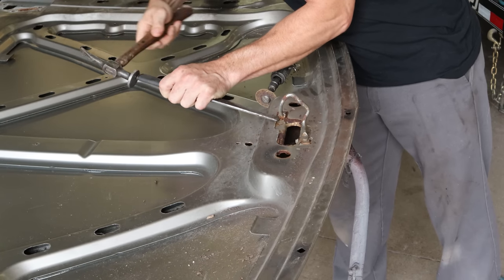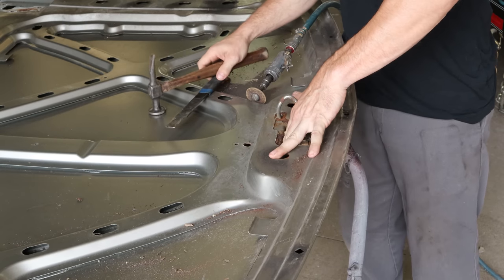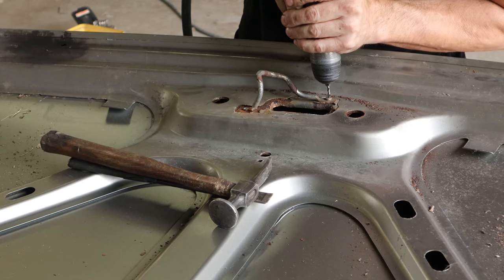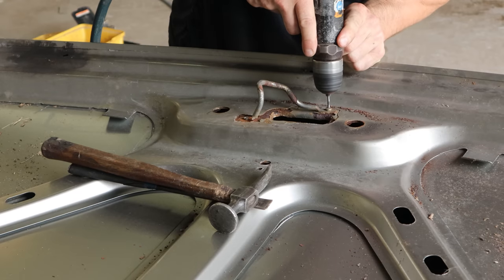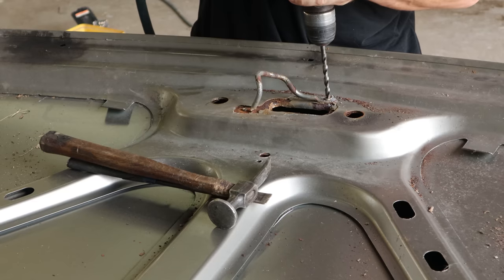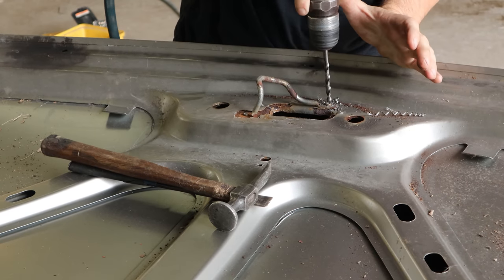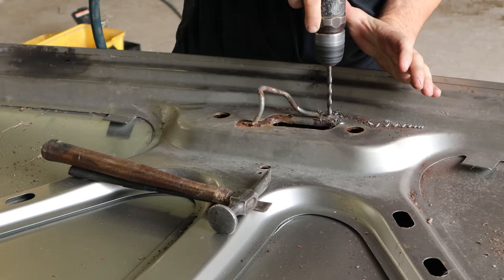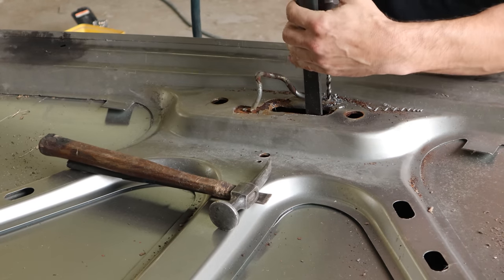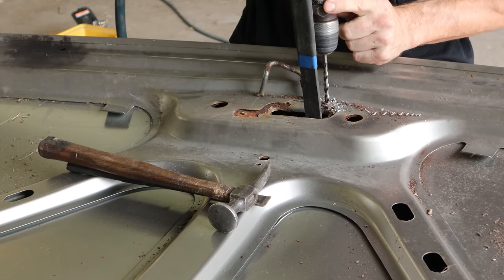So the latch is all mangled — there's no straightening it, it's actually got a crack in it. So we're going to knock it loose. There are some rivets in there, so we ground the rivet out of this side. Of course we ended up knocking the piece down inside the hood — the only place I didn't want it — but we fished it out of there. That method kind of sucked, so now we're going to try the drill method. We're just going to drill out the center of this rivet with our 1/8 inch drill bit, drill a pilot hole, then go back over it with our 5/16. This drill bit's a little bit longer and I really don't want to put any extra dents in the hood. So we have our angled breaker — we're going to pull up on the hood and push down on that, so if the drill bit goes through it would hit the breaker and hopefully keep the hood from denting.